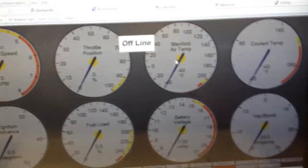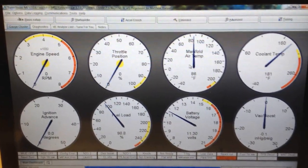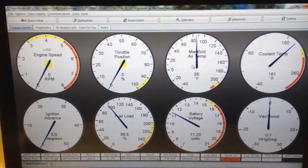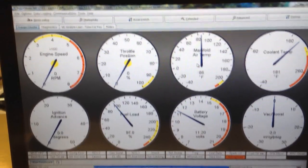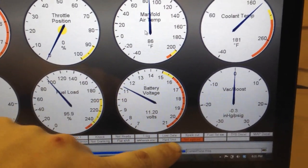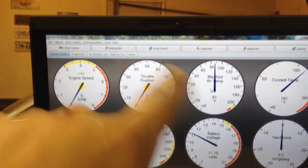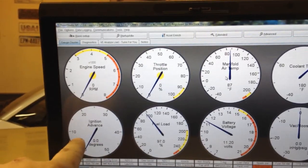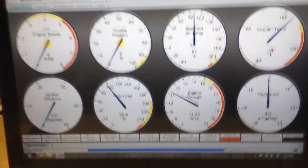Ready to test this Microsquirt. Turn her on. I had it running — 181 degrees, 11 volts; that fuel pump really draws on this. But check out the ignition timing: this guy here says 'not synced.' Once the crank rotates around, it sees it, it matches it — it goes, oh okay — and then wham, 10 degrees of timing and the car starts.